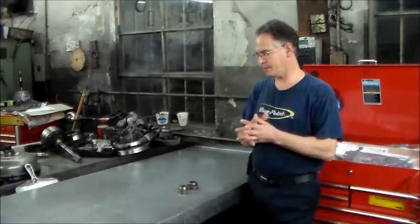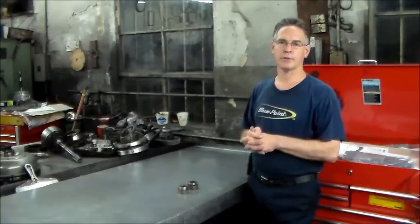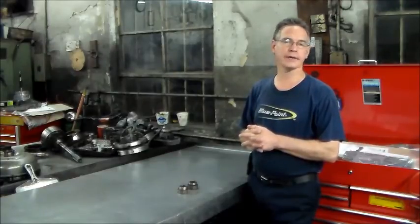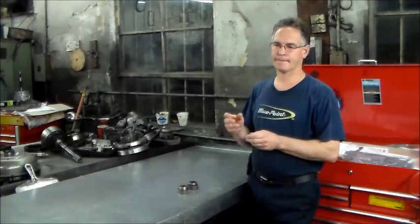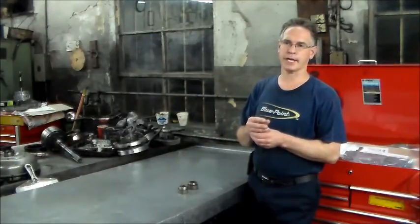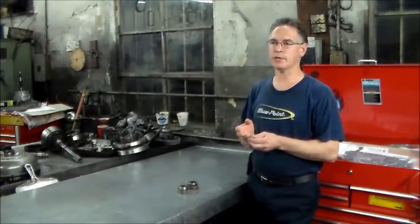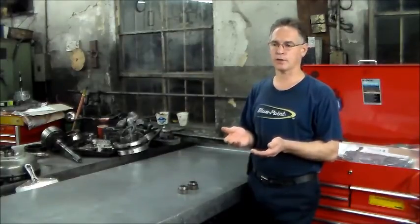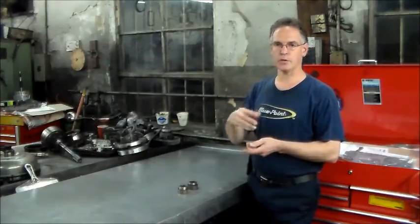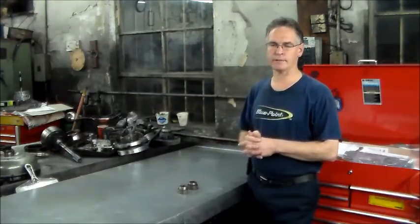So what I'm going to do is focus on the bench now, and give you a close-up shot of what I found with this 4Matic Mercedes. Actually, the drive gear that is bolted onto the rear of the trans that goes into the input shaft of the transfer case was stripped out, and it's easy enough to change, so there was no need actually to do a transmission on the car. We removed the transfer case and changed the gear, cleaned it all out in there, put it back together, and it worked fine. And the gear is available from Mercedes.